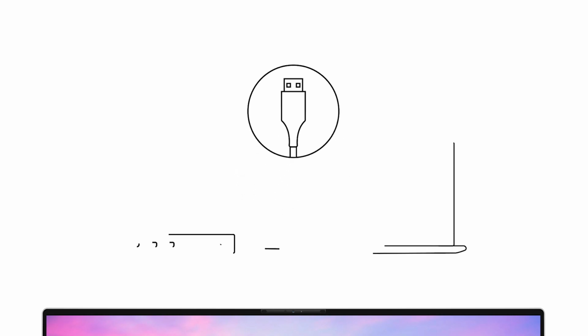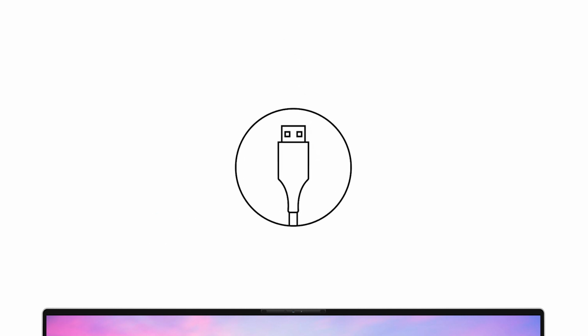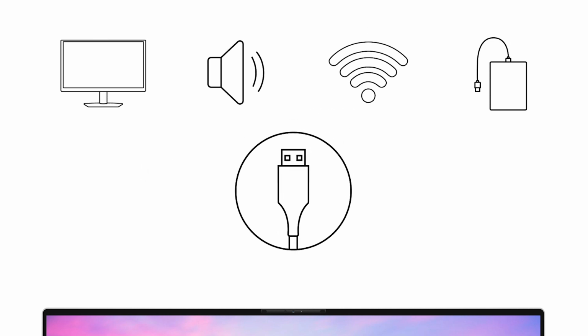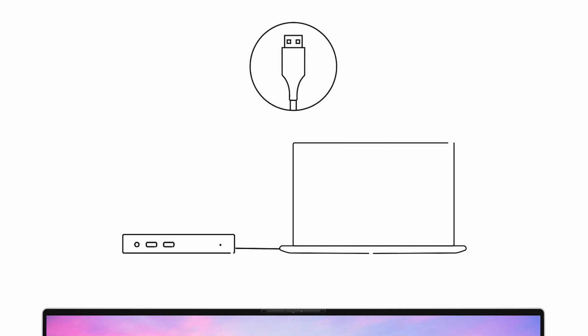USB 3.0 are considered universal docking stations. These work with DisplayLink technology that enables docking feature capability by use of a USB port. This type of docking solution enables multiple monitors, audio, Ethernet, and other USB devices to be connected to laptops through USB ports. They perform their best when using USB 3.0 ports.